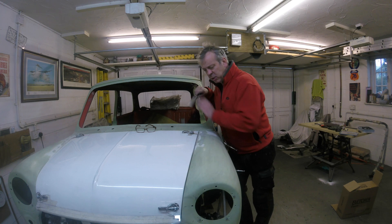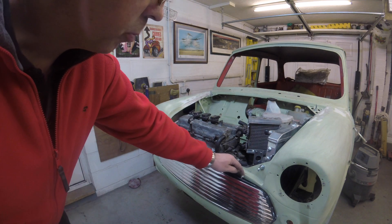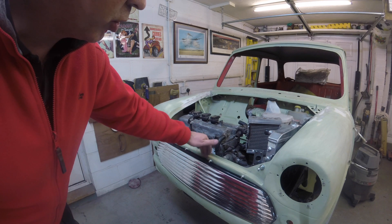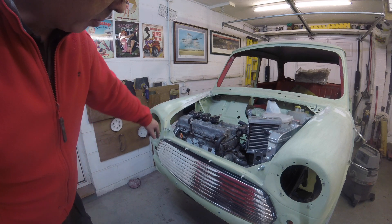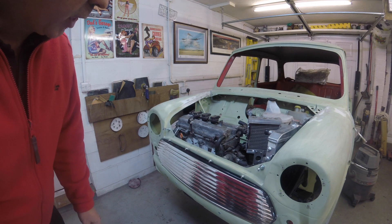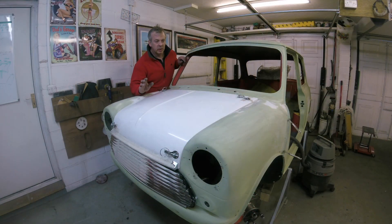And that's the result. Just to end the video: the grill is in place. I've got some little nylon spacer tubes here, which set the grill about half an inch (15mm) off the front panel, just to give a little clearance to the alternator which is really tight. I actually had to cut a bit off the grill — one of the little webs — just to give a bit of extra clearance. I'm putting some rubber seals underneath the bonnet to get a good seal. The grill has a small gap around the sides, but with the trim — the little hockey sticks on — that'll probably go unnoticed.